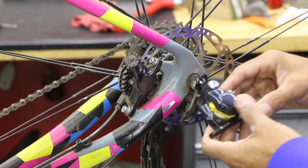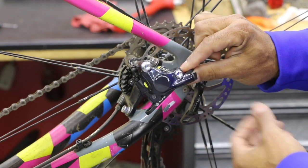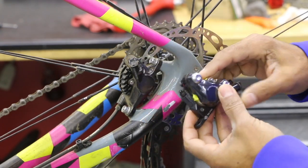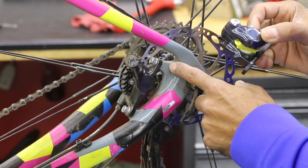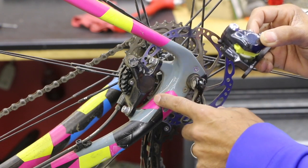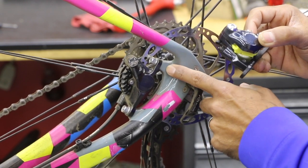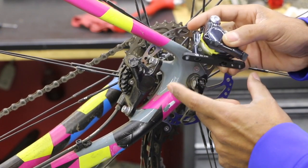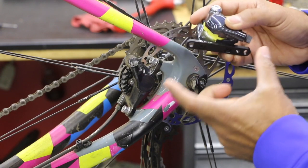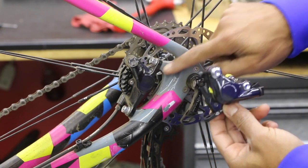Here's some information I had to find out the hard way. I originally had the flat mount style brake caliper and found out that it's not adaptable to a post style mount bike — whether it's your rear brake or your fork. Your fork might have this style as well with the post mount or just the rising material. They do not sell a spacer, which would have been the easiest thing to do — basically a spacer slash adapter that would allow this to fit on the post style mount.